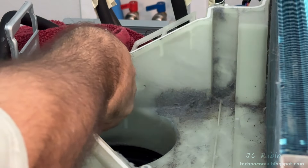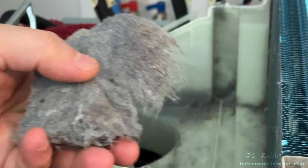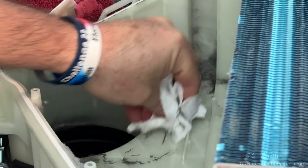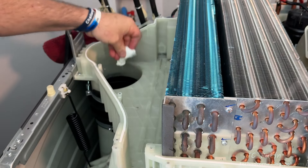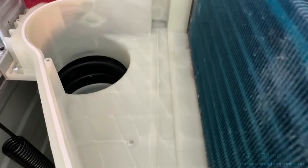I remove this big chunk of debris which comes right out — very cool but very sad, given there's no way to handle this during normal operation. Next is a general cleaning — vacuuming as well as removal of that lint with mild detergent if necessary, making sure not to drop anything down into the hole. This also includes getting that back area, which I found really compacted in the corner. I tried a brush with some spray cleaner to help clean that corner out, and finally removal of lint from inside the pipe.